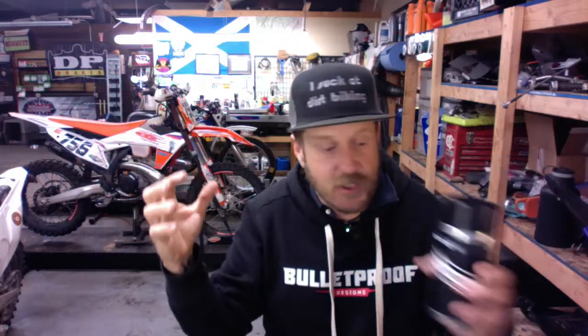Let's see. Brody, hey Morgan, Logan was telling me that if my 85 is not jetted right, it can blow up in the cold. Yes, Brody, that is true. If it's jetted too lean, it will. You have to hold it wide open for a long time, but yes, you could seize it if it's too lean. And when it gets cold outside, quick lesson on how motors work, and fuel injected ones too. They just have a temp sensor to tell it when to be rich and lean. As it gets colder, the air gets more dense. The molecules get closer together. So there's more oxygen per square whatever of air. And when there's more oxygen, you need more fuel to burn correctly. If you have less fuel, it's lean, and that makes it hot.